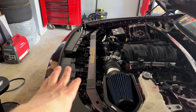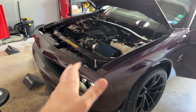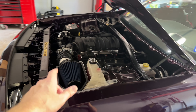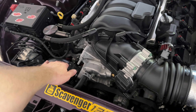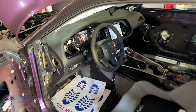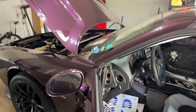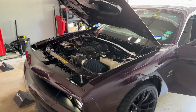We're probably going to end the video after this. I'm going to do a little research to see if there are any other ways to possibly trick the fans into turning on without tuning the car. The fans are now on — I'm guessing the coolant temp will say 215. Yep. So again, same as before — the fans don't turn on until 215 degrees.